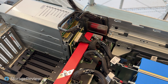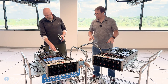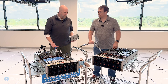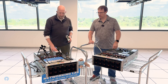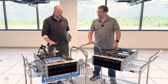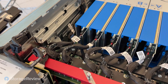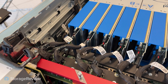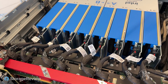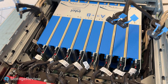These are configured with eight 3,200-watt power supplies on the back. The average power draw we're seeing is just under eight kilowatts. As compared to the 9680 with the SXM architecture, that draws around 12.5 kilowatts, so it gets a little more power-friendly. This allows customers that have threshold levels within their rack power consumption the opportunity to put more of these dense bridged GPUs in.